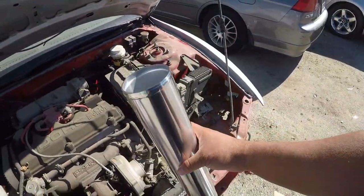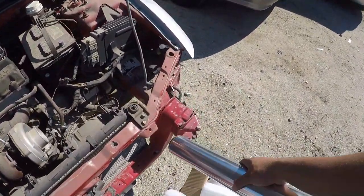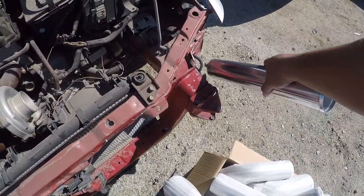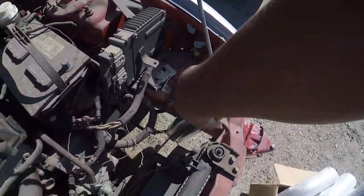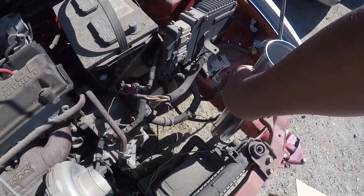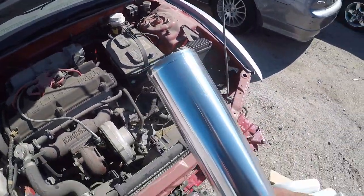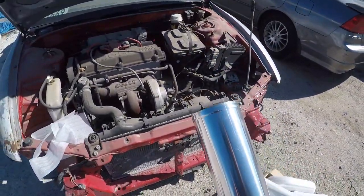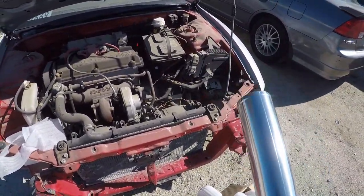So the only places that there might be a leak would be, for example, if I have a piping that curves all the way to the back, I have U's, so I know I won't have an issue with the U right here. But when it comes in through here, I might have to use a coupler right here. So usually the couplers are the weak points if you're going with the boost, because the couplers could pop off. I don't know, maybe they could rip.